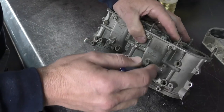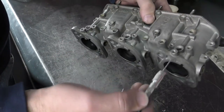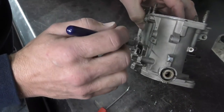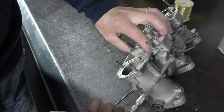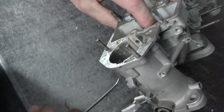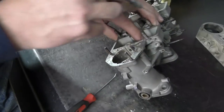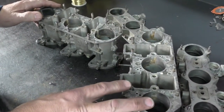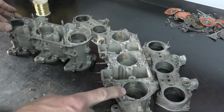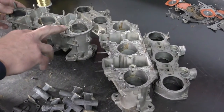These passageways here can be verified without pulling the plug, mainly because you can get a good air nozzle fit in there and get good air pressure through — you can also squirt solvent up here. Rarely have I had to pull these ones out because they're made of brass, not lead, and this passageway cleans easily. Same with the accelerator pump passageways — on rare occasions with a lot of corrosion on a high-value carburetor I've removed these, but because I have good access and they're a large passageway, I can flush them with solvent.